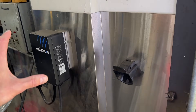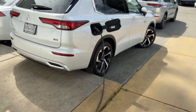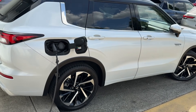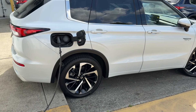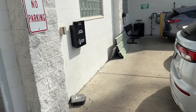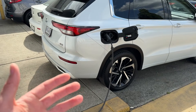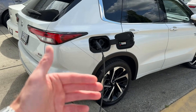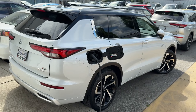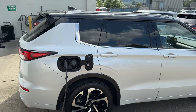Typically those wall chargers look like a box installed somewhere in your house, or you have ChargePoint stations in shopping malls and throughout the city. One thing to note with Level 1 and Level 2 is that those charging times are contingent on full power access. Sometimes even though you have a Level 2 charger, it doesn't deliver full power — I've seen that many times on public chargers — and then it takes a lot longer.